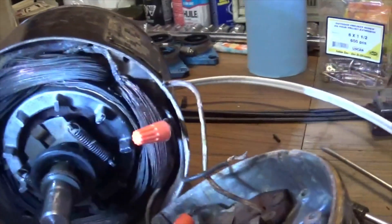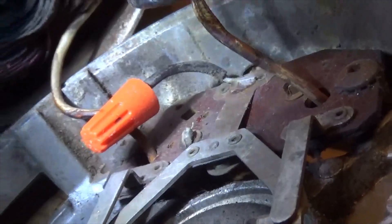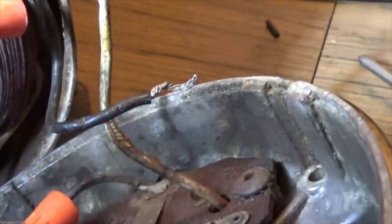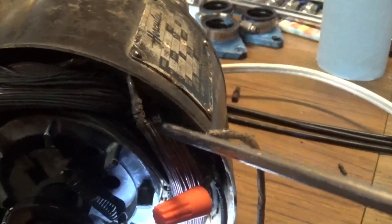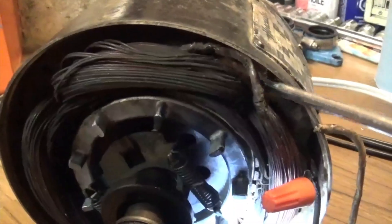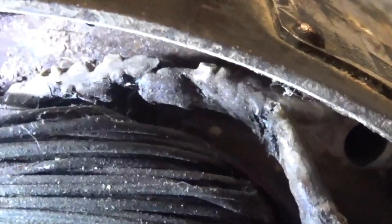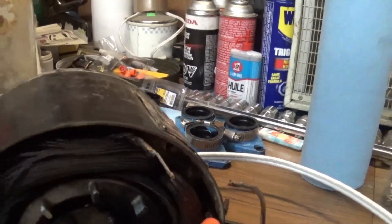This was another classic case of not looking close enough before making my assessment. I thought it was that connection down there. I undid the tape on that white wire and as you can see it's not even right through - there's a spot there that's melted through. It went up behind this run winding and underneath, then was connected here. I happened to notice it felt pretty loose and it pulled right off. I moved it a little bit and the insulation just kind of all broke up - you can actually see the strands right there, and they're all green. That wire overheated. I tried to strip a little bit right here and it just self-stripped way up back - that insulation is just done.